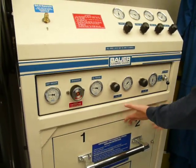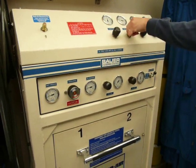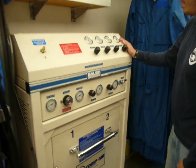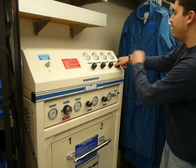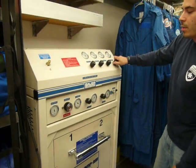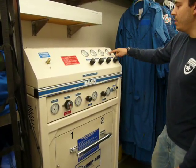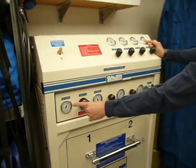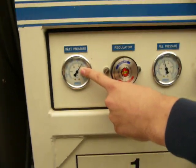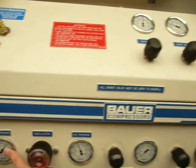So we can close this and lock the door. Once we've locked the door, we're going to choose the bank that's higher than where we're at. That bank is going to be the one at 4,900 or 5,000 PSI. We're going to open this up, and we're going to see that the value in bank 4 is equal to the inlet pressure within 10%. One's at 4,900, one's at about 4,850.